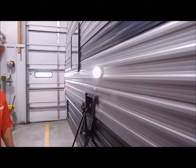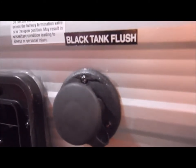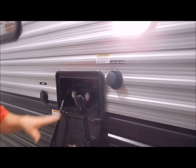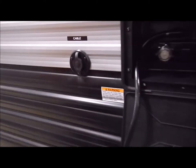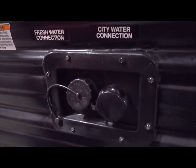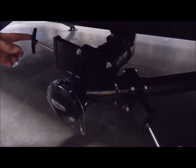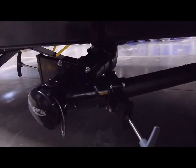Right beside the outside shower is your black tank flush. After you dump your black tank — which is your toilet wastewater — there is a sprayer on the back side of the tank so you can connect a hose to rinse the tank out. You also have an outside shower with hot and cold, and your cable hookup if you're at a park with cable. Underneath the outside shower is your city fill and your gravity fill. The city fill is where you connect your hose at a campsite; the gravity fill is where you fill your fresh water tank for dry camping. Down below is your dump station — the gray handle is your gray tank for shower and kitchen sink, and the black handle is your black tank for the toilet.